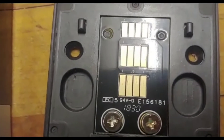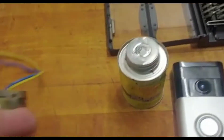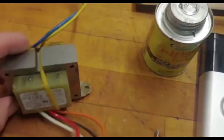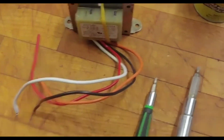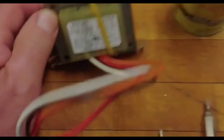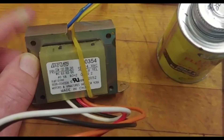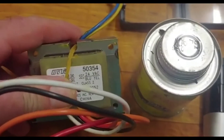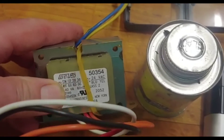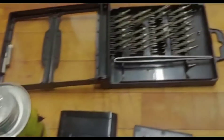The contacts look pretty good — they didn't suffer too much. I'm probably going to do a hard-wiring job using that transformer. I'll mount a little electrical box and run 120V to it. This transformer steps 120V down to 24V AC — it's used for air conditioning — and it's only about $10 to $12 wholesale. It's a 40 VA, 24-volt AC transformer.